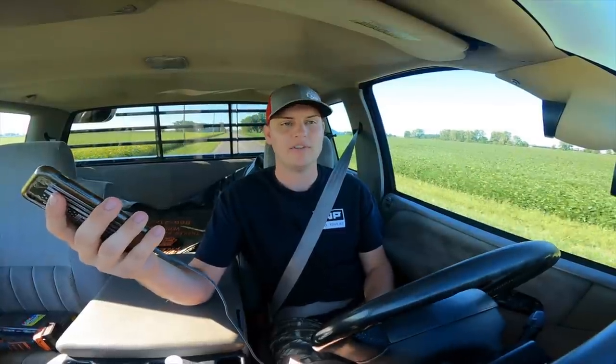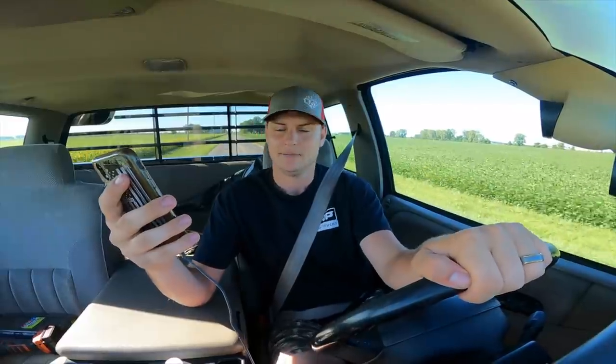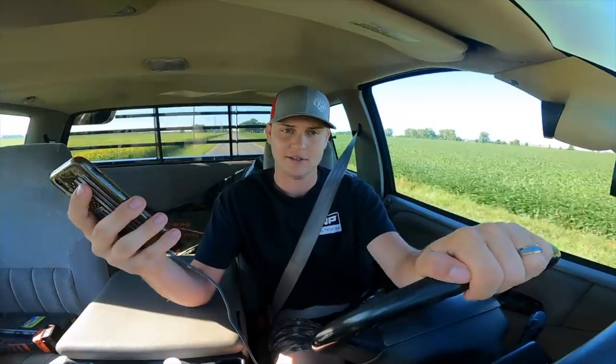Now, if I want to floor it, obviously it'll smoke a little bit while it's trying to build boost on that S475, but it still gets up and moves because it has that small turbo to carry the weight until it spools up the big one.